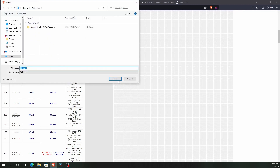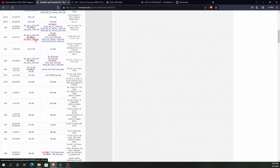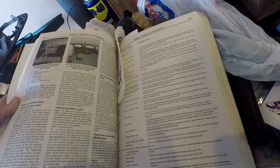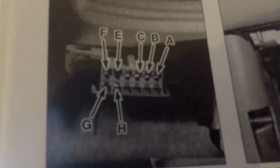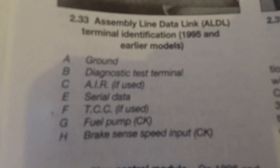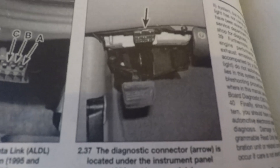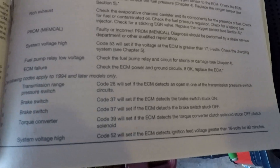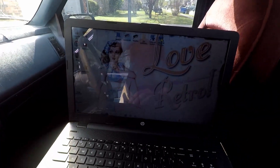You save as and put it wherever you need to. I put them on a USB device eventually, because I'd like to transfer everything over to the laptop. If you have one of these Haynes repair manuals or any other brand, you can head over to the section on Emission and Control System and you're going to find your ALDL connector, your terminal connector, and your OBD1 connector. This shows the V1 and V2 versions and will pin out and show you where everything is. It shows that my data port should be E, but it isn't. And this book will also help if you have any error codes — it'll show you and tell you exactly what it means.